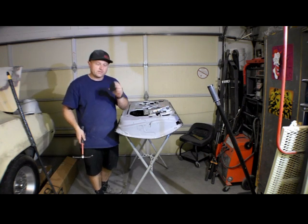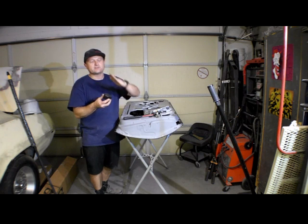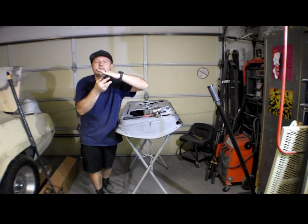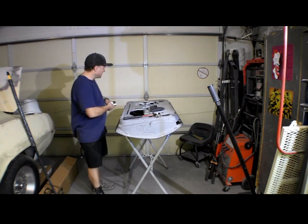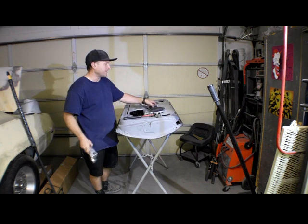Then I took a rubber heel dolly. I placed it at an angle, so if my hand is the skin, I didn't place it flat on there, I placed it at an angle, and I got it down pretty close, and then I took the pneumatic door skinning tool and zipped it along for a nice even crimp all the way around.